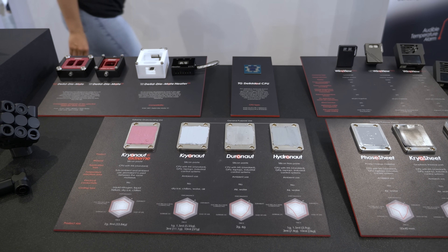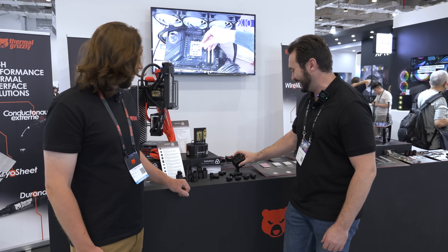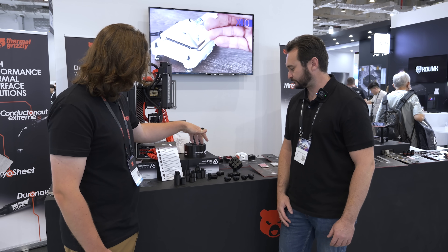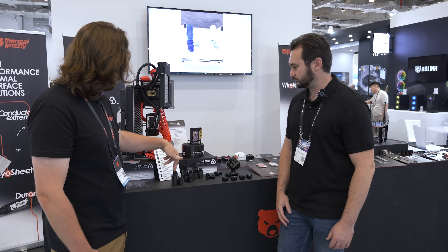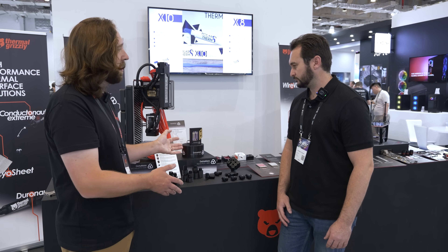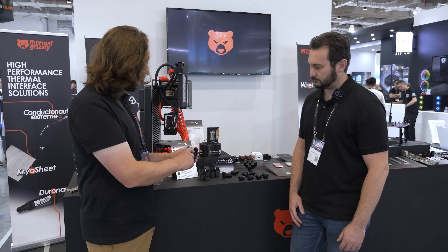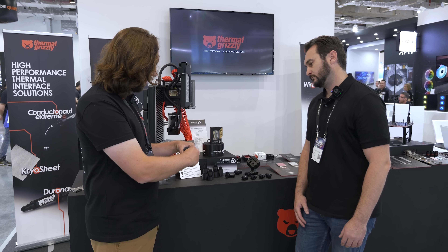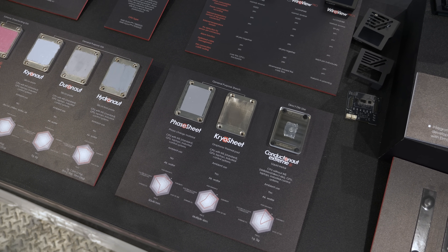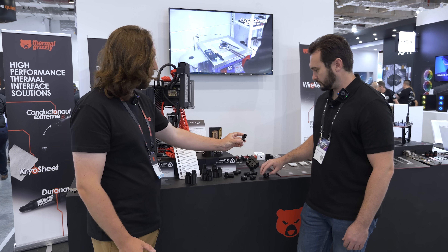Lastly, there are some new fittings and connectors. It's a very simple set of fittings: there's a soft tube fitting, a hard tube fitting, two rotaries — a 90 and a T — a plug, and four sizes of extender. Together they can be combined into lots of other traditional types of fittings. The 90-degree fitting actually has no base at all — you install it with an 8-millimeter hex key, and it's free to rotate about that even without the base. Then you can extend it to be the size of a traditional 90-degree fitting.